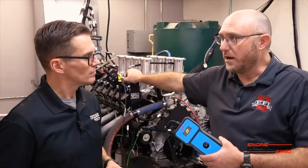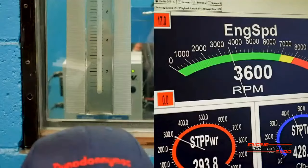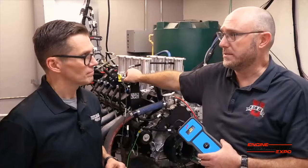That factory engine works real good. Now of course if we started doing other stuff with it — turbos, boost, nitrous, lots of RPM — those rings are pretty big and heavy, so we would obviously expect to see more blow-by. But we have old-school ways that are reliable and new-school high-tech ways. However you measure it, as long as you're paying attention to it, you can start building a database and know what changes you made to the engine affected blow-by in what ways.